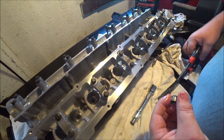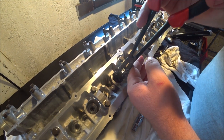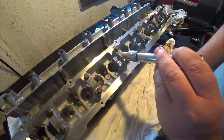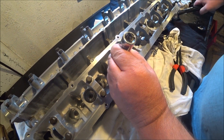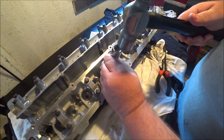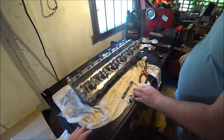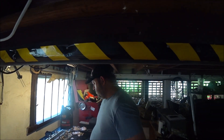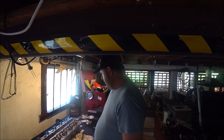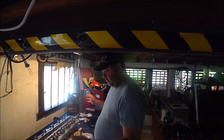Let's try that again. I'm trying to grip it very gently so as to not damage the seal and just pop it on like that. We'll take a drift — it goes over the top, make sure it's nice and square. And that sound — that's home. And that's your valve stem seal installed. It's a pretty easy job, pretty quick. I'll clean up those two and then start on lapping the valves, and then I'll be able to put the rest of this head together.